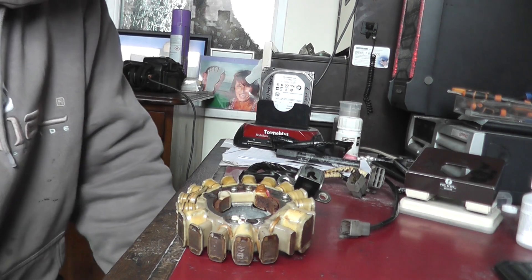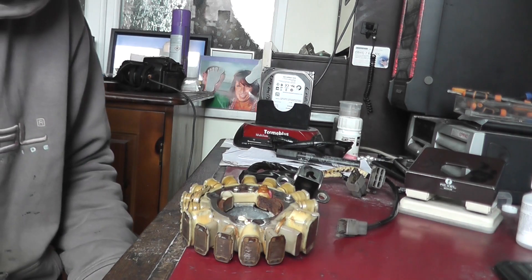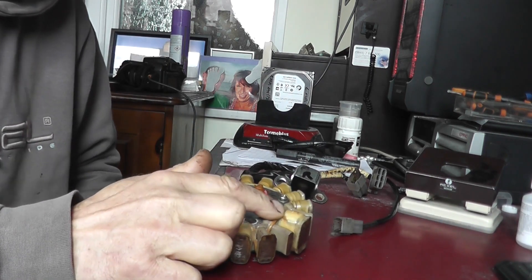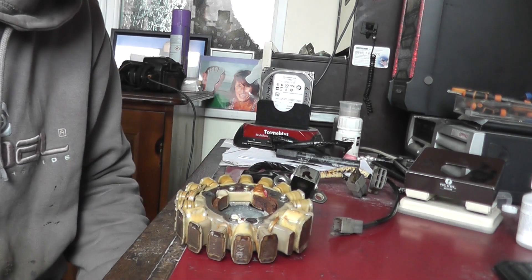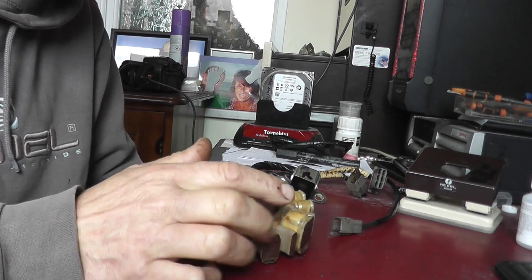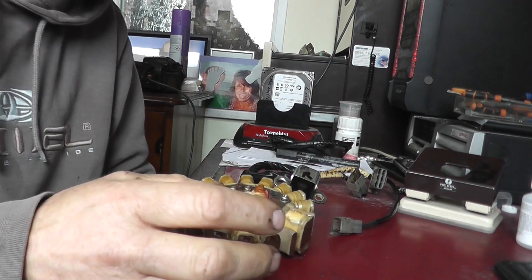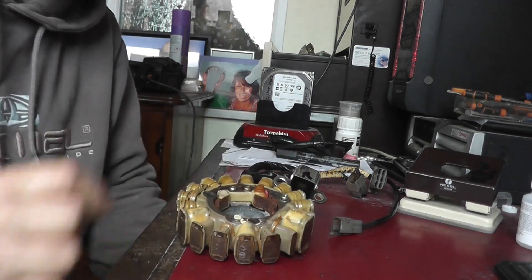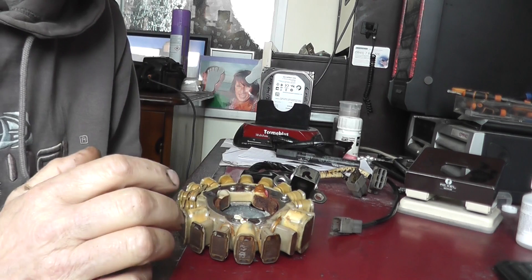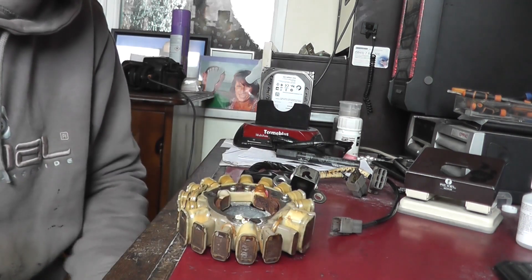On these source coils — the two low speed source coils — the smaller one has about 1,200 turns and the larger one has about 3,000 to 4,000 turns. I'm suspecting the wires have probably fused together somewhere in the circuit — they've rotted and joined together — but there's also a wire that might be slightly broken. So it's giving a kind of correct ohms reading but not working properly. One fault is counteracting the other: one wire is probably broken somewhere, and a lot of wires are fused together, giving you a false indication that the coil is good.